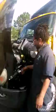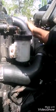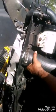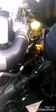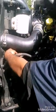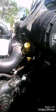With the hood open, we'll check our sleeves and our hoses for dry rotting and cracks. So we'll kind of squeeze and put a little pressure on there, check for cracks and cuts. You don't want to forget this power steering hose up under here. While we're checking hoses for cracks, some of them are braided, so you have to squeeze them and feel for moisture, but there's no moisture there. So we'll go to the other side and check our hoses and our pipes.